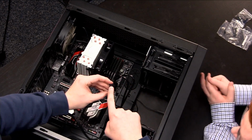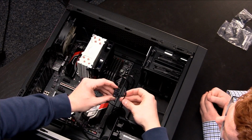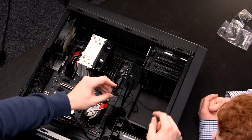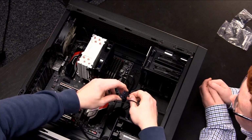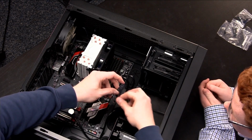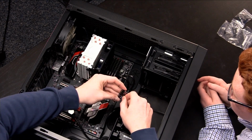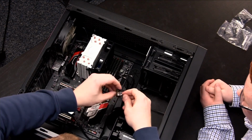So it actually makes the process a lot easier. If you look at this device, you can see how it has HD plus and minus. That stands for hard drive, plus and minus. So you look at this where you have the hard drive and it matches up, right? And you basically push that down in there until you hear it click into place. Okay. This one says RES plus and minus, which is essentially reset, right? So you find a cable that says reset switch, and you put it down into there as well, right? And then you have power LED. This one's a little bit more of a pain because it has a positive and a negative. And on these, you can see they're actually separated. Yeah. So we'll put these down. Let's see, there and there. Okay. I think that's lined up.